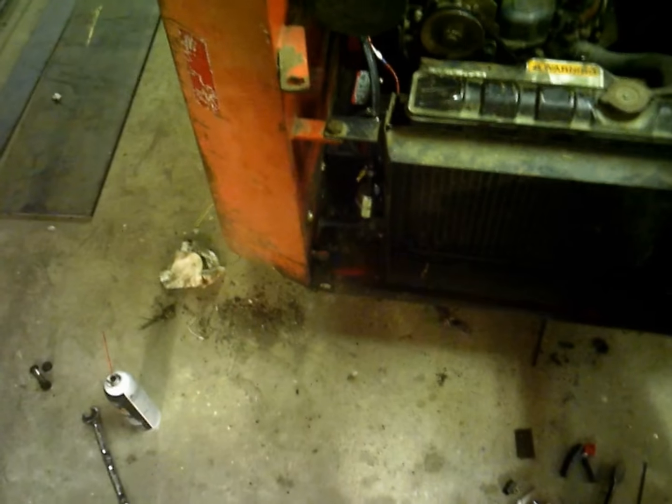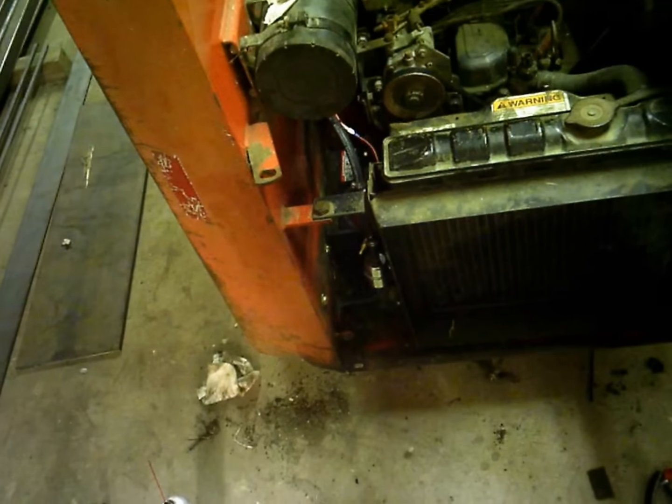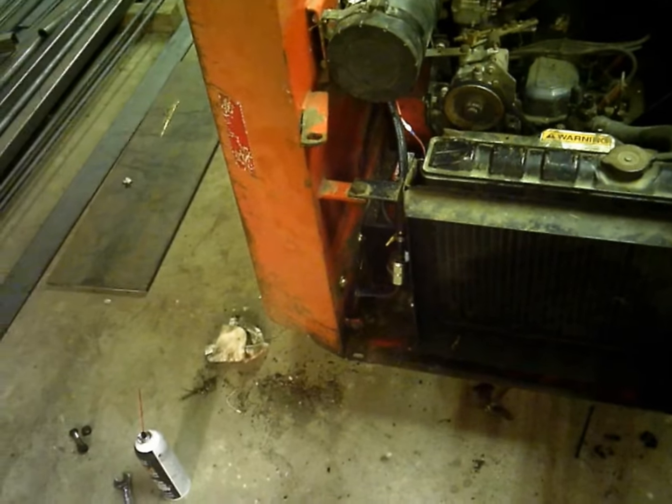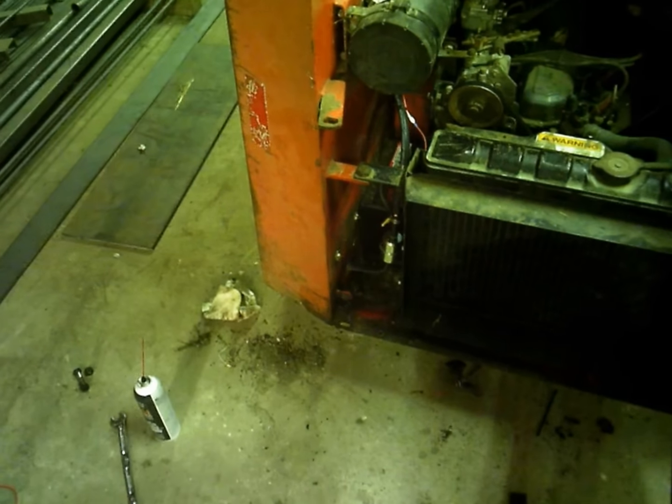I had asked everybody to give me their input on the fuel tank plug. A couple guys said plastic welder, but I didn't really want to pull the fuel tank out — I wanted something I could do in place. Some other guys said other types of adhesives, but the ones I liked best: Burning Dinosaurs mentioned it, and Old Farmer and Chuck Stevenson also said it — JB Weld it. I remembered after they said that I've seen JB Weld on gas fittings before and it doesn't seem to eat it away. So that's what I did.